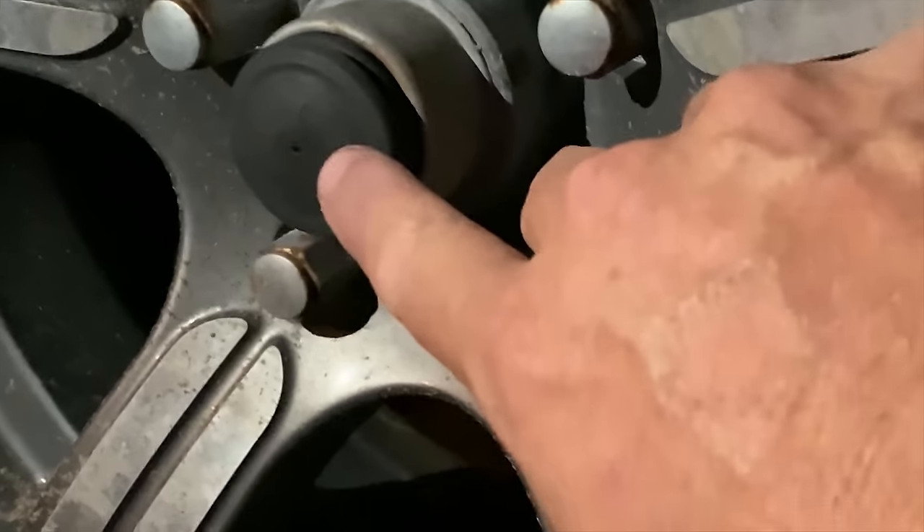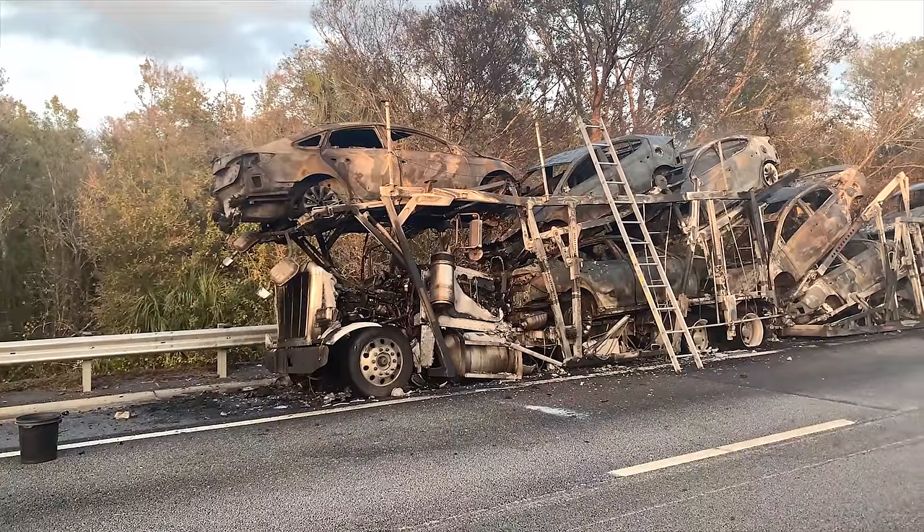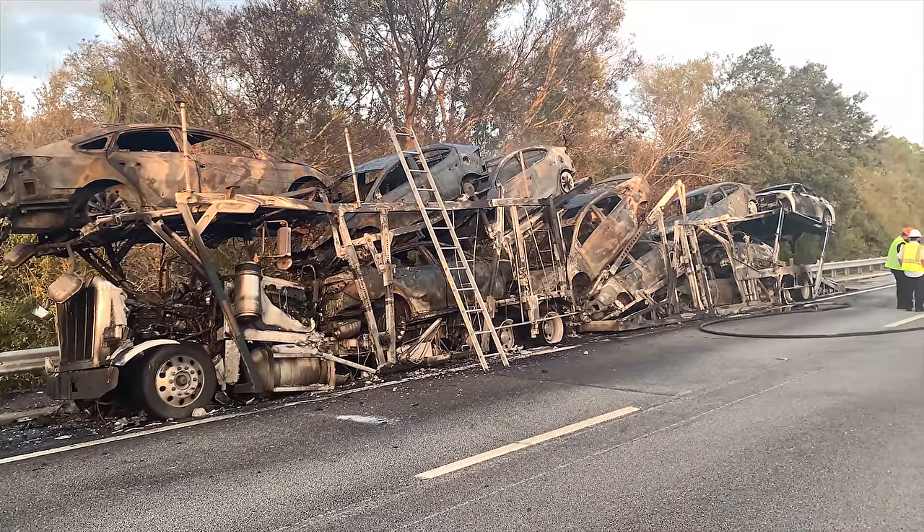We made it here. We are at the Plantation on Crystal River, and I just wanted to show you how awesome this is. As long as I press that, see how there's air pressure in there? I know that my bearings are perfect and these things will last a lifetime because they're airtight. They keep the water out, the dust out, they keep everything out. I did that like six, seven, eight months ago. I've been trailering this boat everywhere — saltwater, freshwater, dirt roads, you name it. To be able to make it where I'm going, arriving sound is everything. Today on the way here, we saw the biggest car fire in the entire world. When I went over and talked to the driver of that truck, he told me he had a problem with his bearings on one of the axles on the trailer, which got hot, started a fire, and it was terrible. And that guy was a fan of the channel, which is crazy. Drop a thumbs up if you think I should call him, get in touch with him, and take him fishing, because everybody experiences a bad day from time to time.